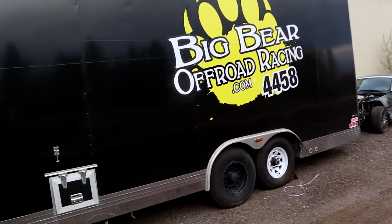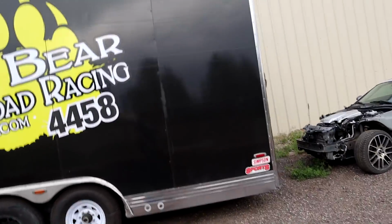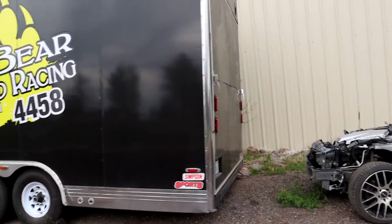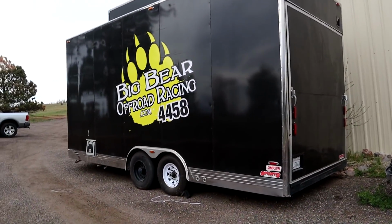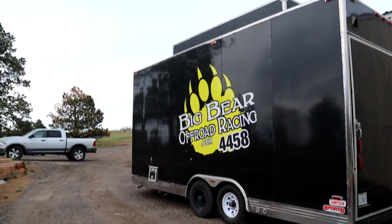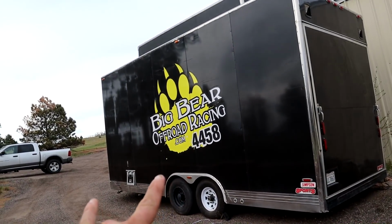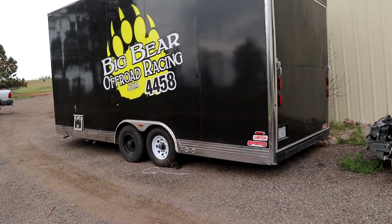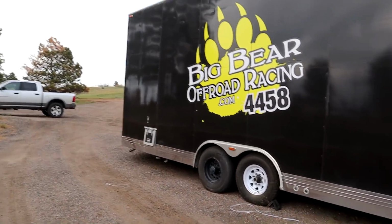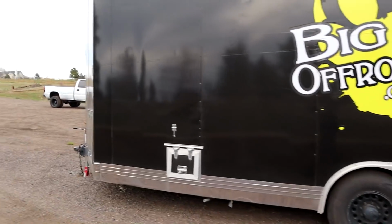That was not an issue. The issue was the suspension. It was lifted. It needed a better hitch, and it being on 37s, it's just not made for hauling this big guy here. Because if we do the math, this trailer's about 9,500 pounds, and then we throw two cars in there. If they're two Ultra 4s, you're looking at 4,000 to 5,000 pounds each. So let's say 4,500 pounds, it's 9,000, 18,000. Throw in tools, spares, everything, you're pushing 20,000.